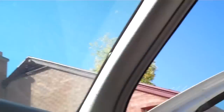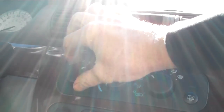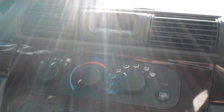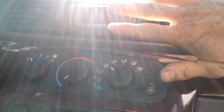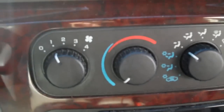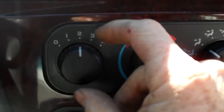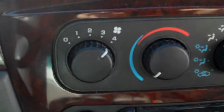That's how you do it — you stick this back in. Turn the key on. Four works. Three works. Two. One. Isn't that nice? You can feel that blow. Same dial, a little bit more. Beautiful. Blower motor resistor — that's how you fix it.